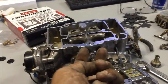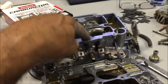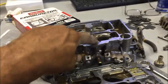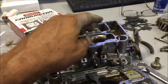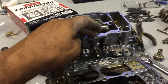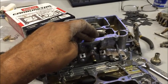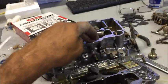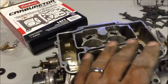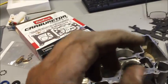You're going to tighten them all the way down and then back out — that's where they set. It's a 650, so I'm going to set these at two, which just means two full revolutions. And then we'll adjust it when it's on the vehicle. Anything bigger than a 650, I like to adjust at one and a half, one and three-quarter. Anything smaller than a 550, you can come out a little bit further. So this one we're going to put at two. If you're not sure, just put them all at two.